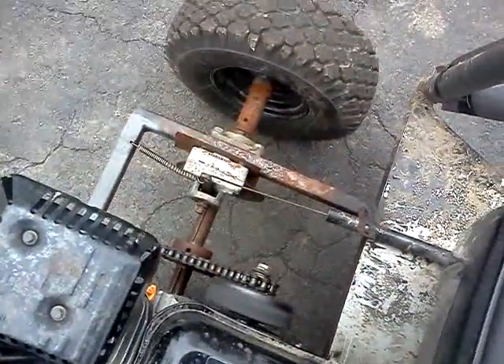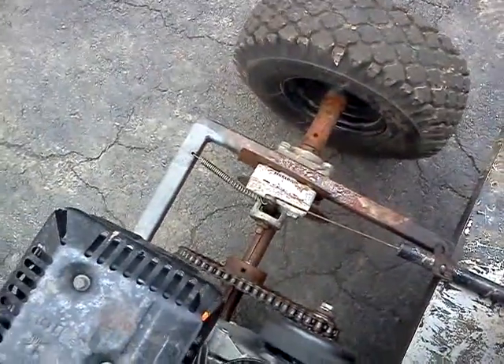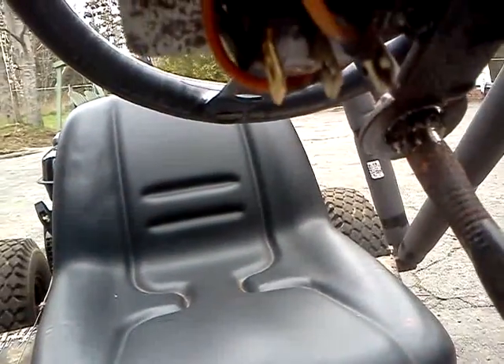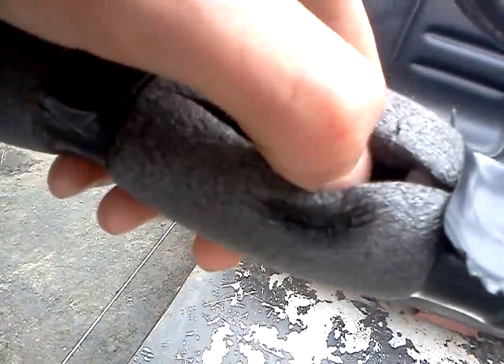This is the brakes for these go-karts — the ones that this one has right here. Just checking how much those were and they're 60 bucks. They have disc brakes themselves, but 30 bucks or something — it's a lot cheaper. I can only get the kill switch hooked up properly; I just had to solder it a bit. Just heated it up with my lighter and stuck some solder to it. Probably can't see that little bead, but it gets a good connection — that's all that counts.